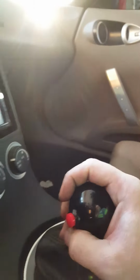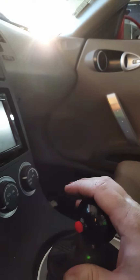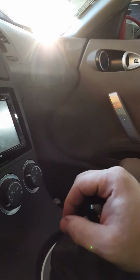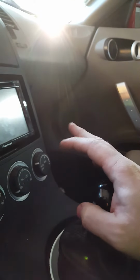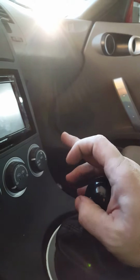And also, when using nitrous, you have three safety switches. You got your bottle valve, you got your switch, which is number 2, and then you got your button. All 3 of them have to be on in order for the system to work. If one of them's off, the system will not work. And also, I ran it here because I'm good at coordinating here as I shift.